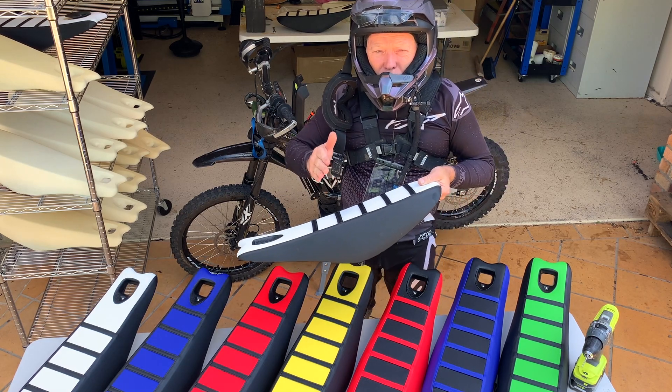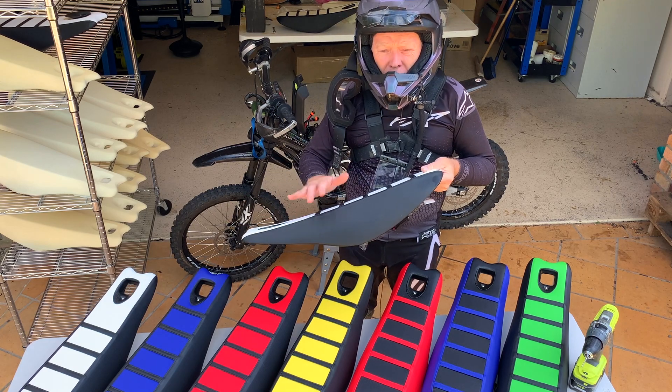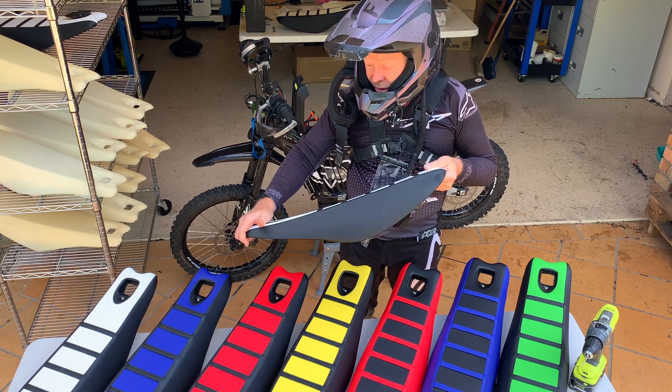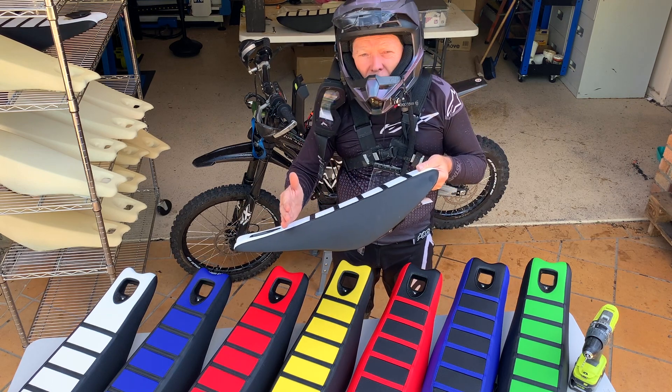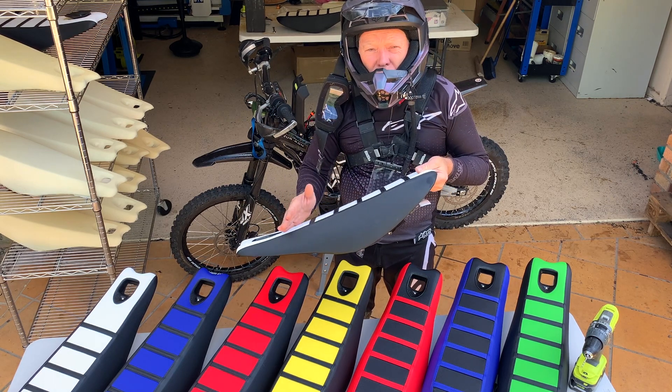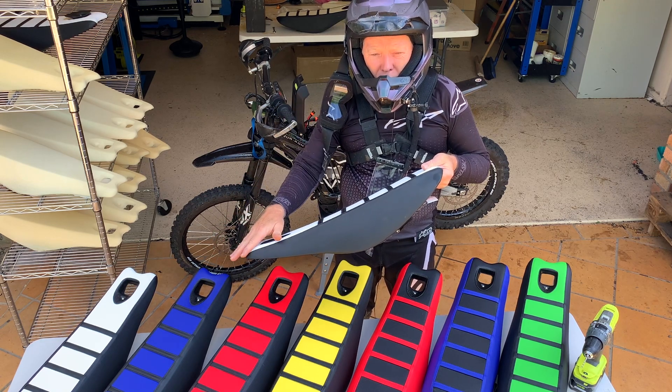So you do need to move further forward, and hence we've designed an MX style seat. That's why an MX bike does have this extended seat. The MX rider will ride very high or very forward on the seat to get as much weight over the front wheel as possible to give it maximum traction.